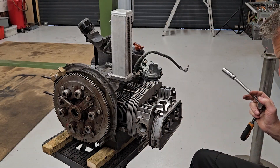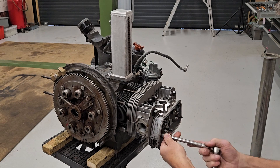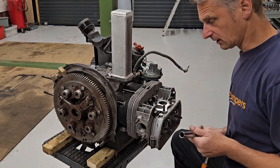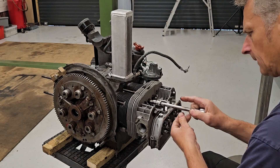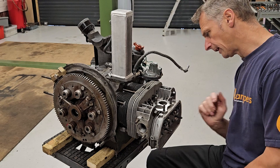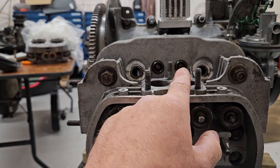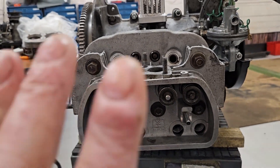All the nuts are in place on the cylinder head, so now I'm just starting gently winding it home — nice and evenly in a nice even pattern across the cylinder head. Checking everything has sat in nicely, tubes are tight and you can't spin them. Then not to forget the Allen key nuts at the top — everything is nipped up and in place. The seals look like they've sat nice, with a little bit of sealer oozed out so we know we've got a good seal. Next is to torque the cylinder head up correctly. On this one I'm going to start with a sequence: one, two, three, four, five, six, seven, eight — that keeps everything square as it tightens up.